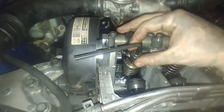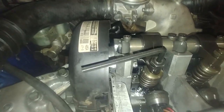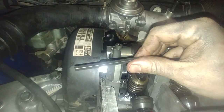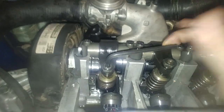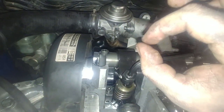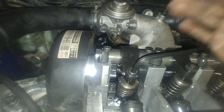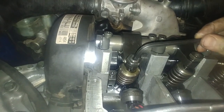According to the manual, this is basically just past TDC. You would then take an Allen key and rotate it to full end until the resistance comes — resistance is right about there. You don't want to force it, just where it bottoms out. Keep in mind you've got your injector nozzles there; you don't want to put force on this or you're going to destroy your injector. From here, according to the manual, you must rotate 225 degrees out.